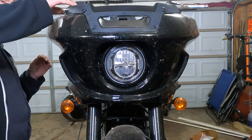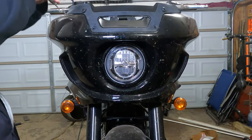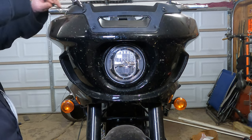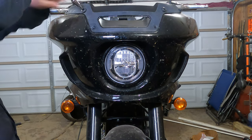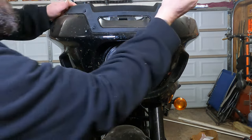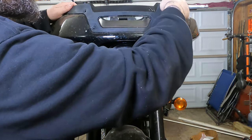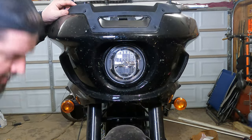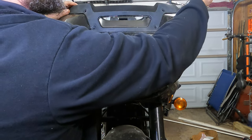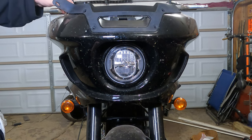When removing all the fairing bolts, you want to be careful to go around and break all of them free. You don't want to have just one bolt holding the entire fairing on. So break all of them free and back them quite a ways out. Then once that's done, you can go around and start removing them. Just leave maybe the top two in there by a few threads. Once you get all the screws out, remove those top two, but remember to support the fairing as you do it, because that's the only thing holding the fairing on and the fairing is also holding the headlight in place — so there's a little bit of extra weight to manage.